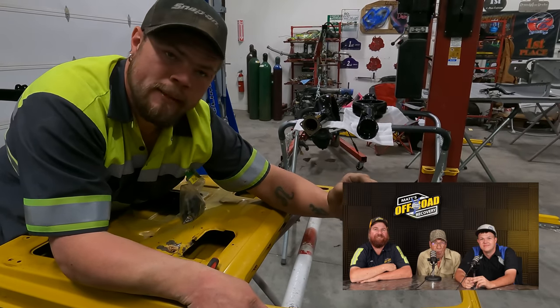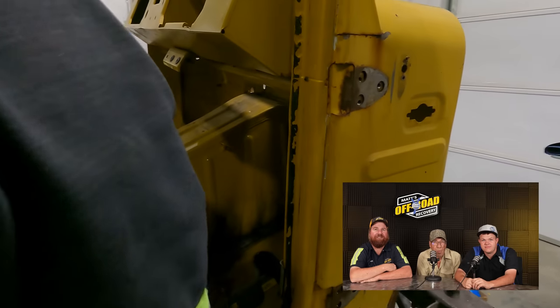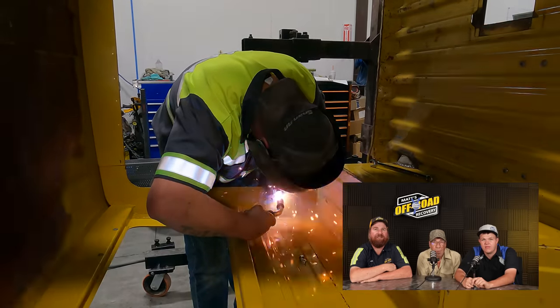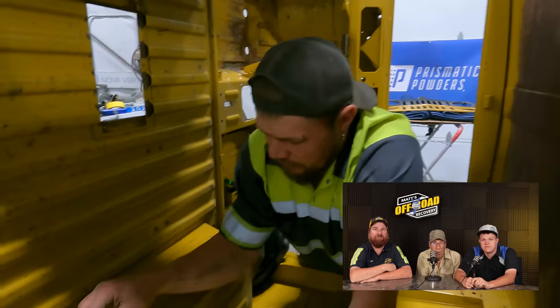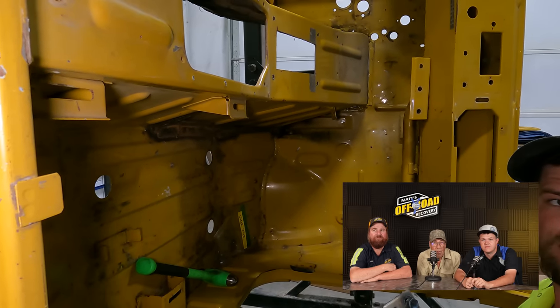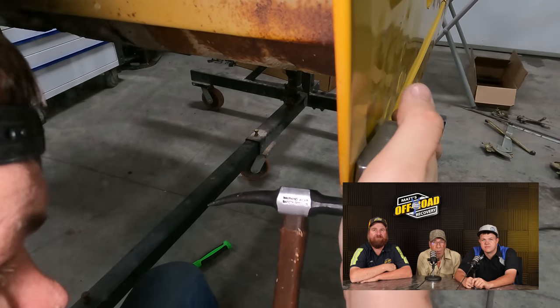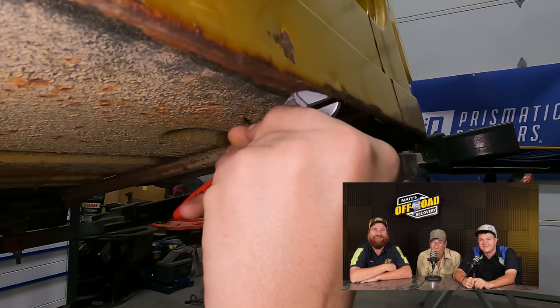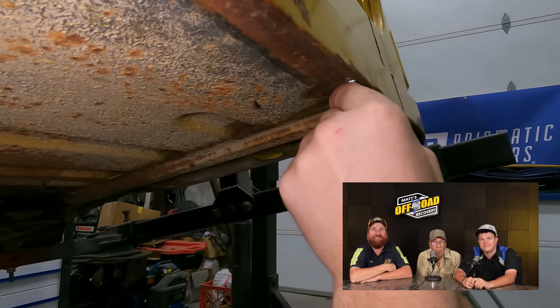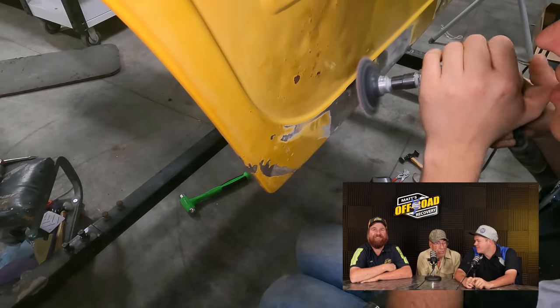Now I'm going to work on getting this door guide out — careful with the tabs so they don't break. I got the window channel pulled out — it's still cracked, brittle, ripped in half in some spots. We took all the housings and everything and had them all sandblasted and powder coated. The whole frame and axles and everything are all powder coat. We had to weld nuts on about 20 of them it seemed like.